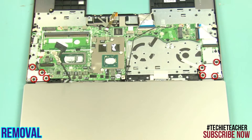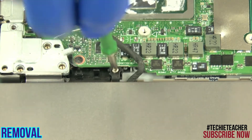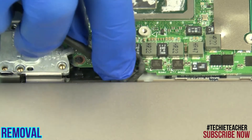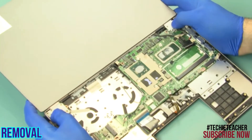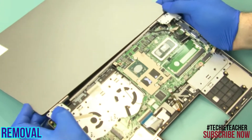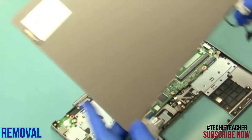Remove eight screws. Remove one screw, remove two, and remove the bracket. Slide the LCD assembly to the left to detach the left hinge, then slightly lift it. Apply a little rotation to detach the right hinge and the cable.